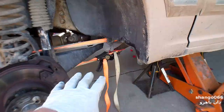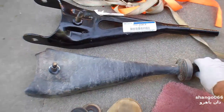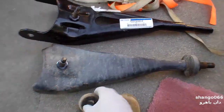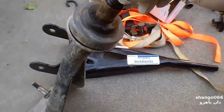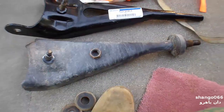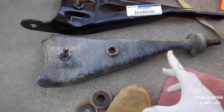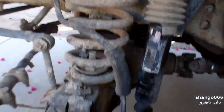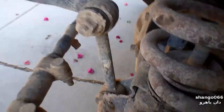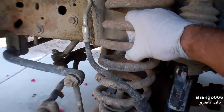The first thing I'm going to do is pull the straps off and try to get the radius arm off. You can see what's going on here — the bushing actually looks very good on this. The big bolt was inch-and-an-eighth, and the shock was 18 millimeter. This would be a lot easier with air tools, because the nuts they use are the crimped locking nuts on the back.